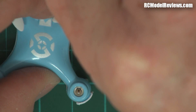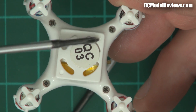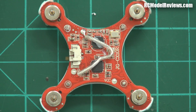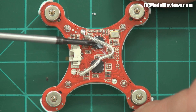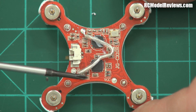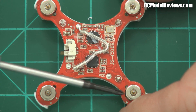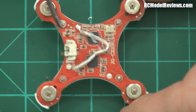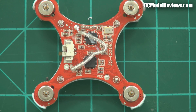Inside there are some little motors — they will be brushed motors, of course, because they're practical and cheap and the most sensible way to do it. I forgot there are some little screws underneath as well; better undo those. So there's the lid off. What do we see when we get in there? Well, there are two little processor chips here — one's probably the RF chip, and this will be the logic chip that decodes all the signals that come out of the RF. We've got a little 25mm piece of wire acting as an antenna, the power switch, and that's the charger connection there. We've got our four motors, a little crystal over here used to clock the chips, and some small passives — tiny little components. Let's flip it over to see if there's anything on the back, because I see no sign of ESCs or anything like that.